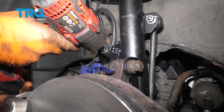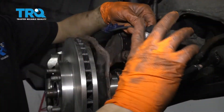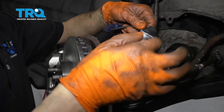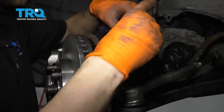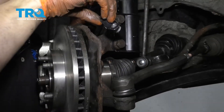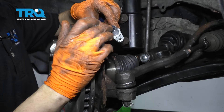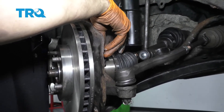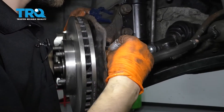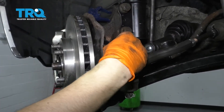Start in your bolt and snug it up. Before I put this in, I'm going to put a little bit of anti-seize right on here. This will hopefully prevent it from seizing into the knuckle in the future. You can also use a little bit of grease — just don't put too much. Before you insert it, make sure there's nothing attached to the little magnet on the tip there, otherwise you'll get a false reading. Start it into its hole, start the little bolt in, and snug it up.